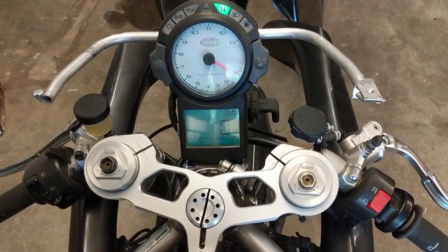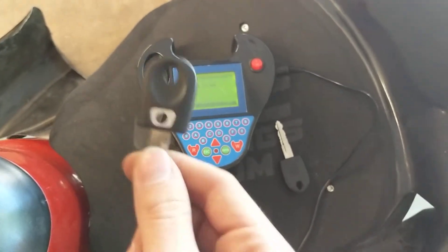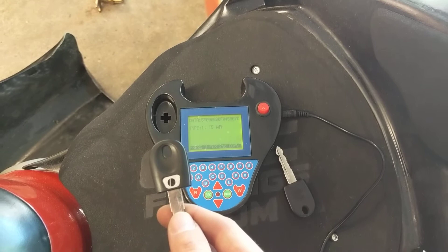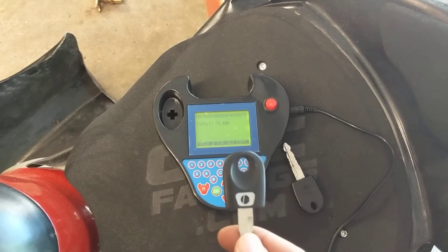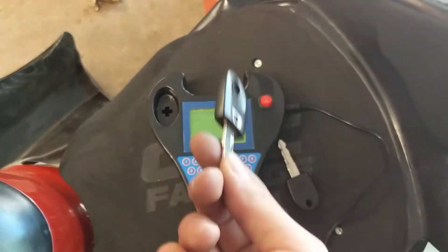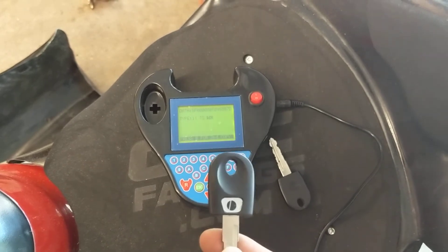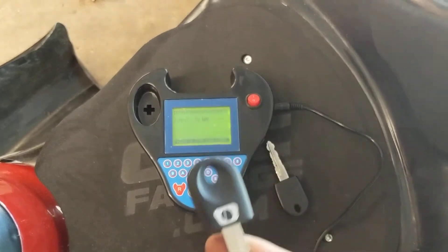This is the first time I've tried this — it's a quick $30-$35 way to clone your Ducati keys. I don't know if it will work for an original OEM Ducati key, as it's basically reading from a T5 transponder chip onto another T5 transponder chip, so that's a small caveat. But if you have one of these, maybe save yourself some bucks going into a Ducati dealership or a locksmith and do your own key cloning. It only cost me $5 to have this cut and $28 for the blank. Maybe not the most cost-efficient if it's only a one-time thing, but if you have several bikes or plan to do it in the future, it might work on other transponder-type bikes or cars and may be worth having in the toolkit.